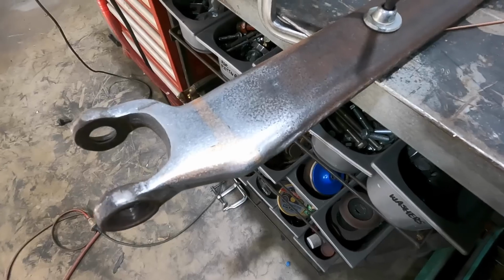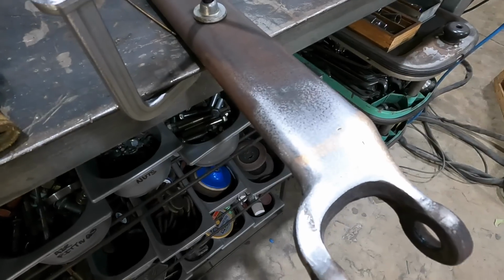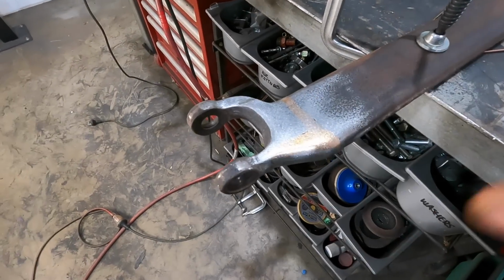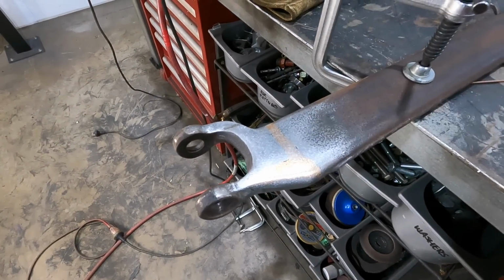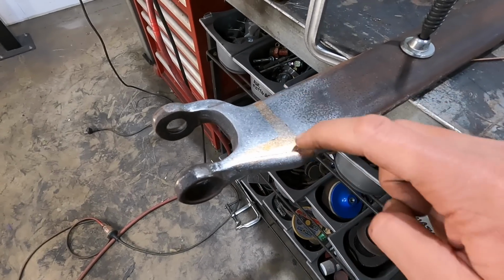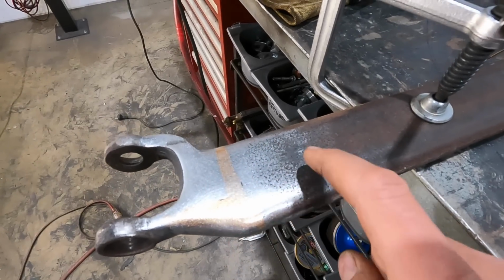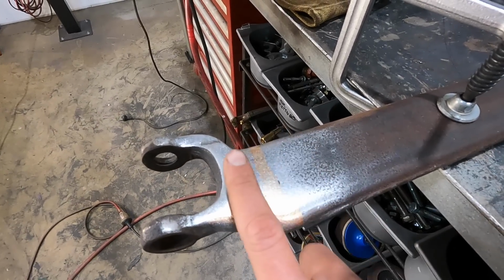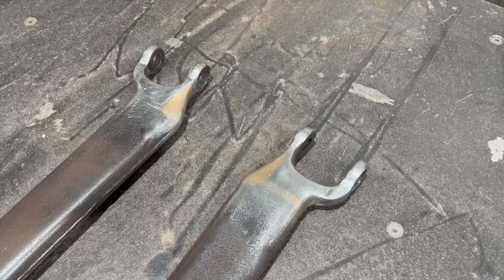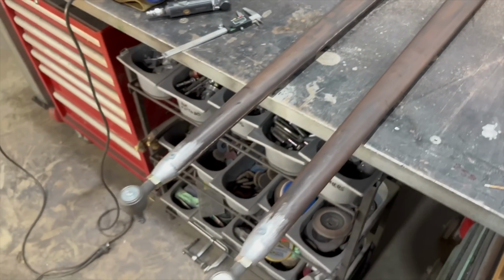So it virtually disappears. So you can have a really nice metal finish. And like I said before, the weld in there is extremely strong. We've done 2 passes and a fillet pass, and basically I've just used the silicon bronze to smooth it out. What I'll probably end up doing in the future is making a really nice fish plate that will sit over top of these. But for now, we're getting there. I'll meet you down the line.